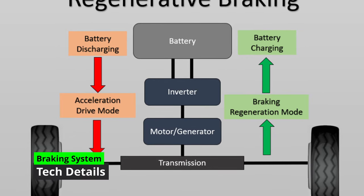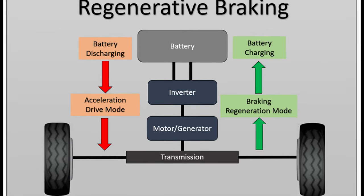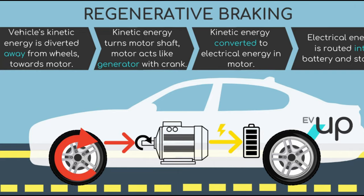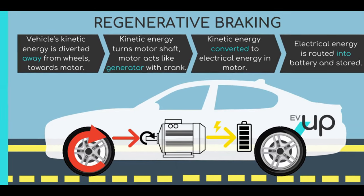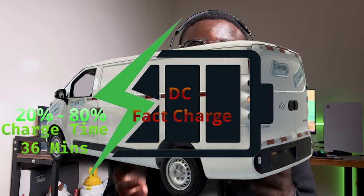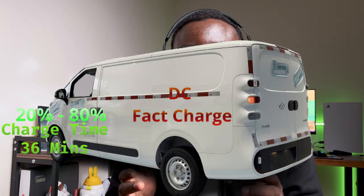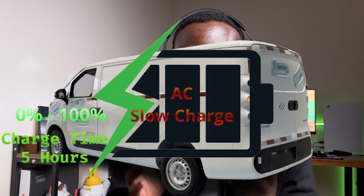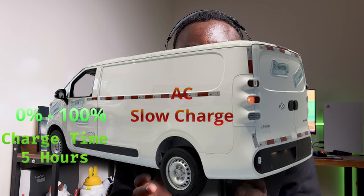The Dana V1 uses an adjustable regenerative braking system — also called brake energy recovery — which improves efficiency and increases range by recycling energy that would otherwise be wasted. Battery capacity differs by trim: SALT is 43 kWh, SALT Plus is 42 kWh, SAHT is 43 kWh, SAHT Plus is 42 kWh, and both long axle trims have 51 kWh. DC fast charging is available on all trims — from 20% to 80% in about 36 minutes. AC slow charging takes about 5 hours for long axle trims.